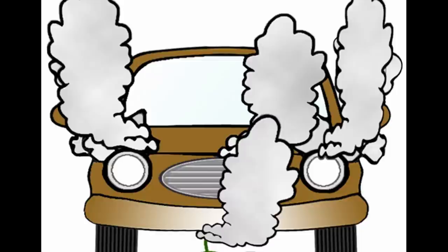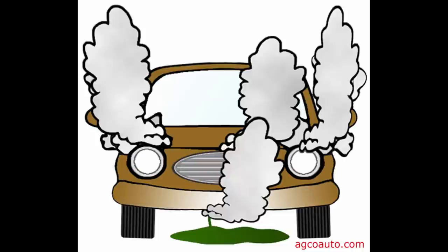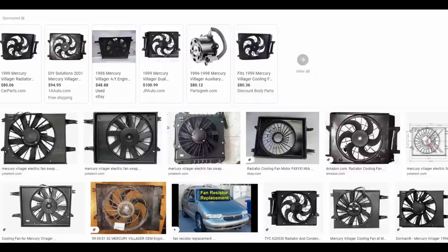For the cooling system, I've always used the stock radiator on every swap and they're all sufficient. I'm running a stock 250 radiator in Daryl — been driving it in 85–95 degree weather with no overheating. Any modern electric fan moves more than enough; they all move 1500–2000 CFM. Popular choices are Taurus fans, Mark VIII fans, Mercury Villager fans, and Dodge Intrepid fans because they're large. I use the PCM to trigger the fan relay and that's my whole cooling system.